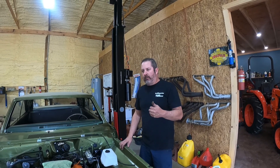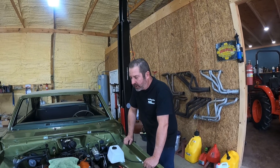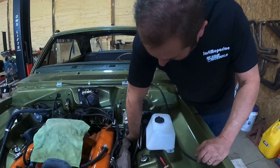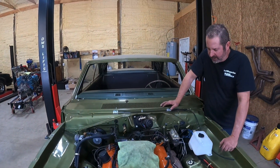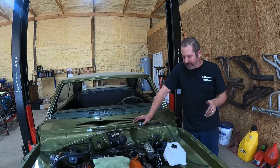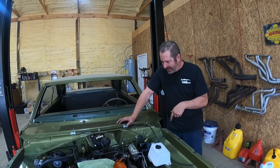Kevin has spent a lot of money researching and trying to find those parts, and we have several shop manuals. I called Brewers and Brewers said that's the one piece — that interconnect rod. It goes from the column to the lever on the column, and then this goes to another Z-bar. So it's basically got two Z-bars: a Z-bar for the clutch and a Z-bar for the interlock system. I also want to thank Jamie from Dead Dodge Garage — he took the time to call me and go over a few possibilities of what the issue was. Brewers said that's the one piece nobody remanufactures because basically it was a day-two thing where people would put headers back in the day and they would just chunk it because the headers wouldn't work with all that. They would just get rid of it and safety wire that lever down.